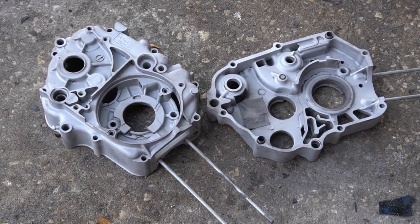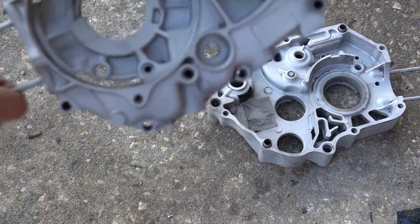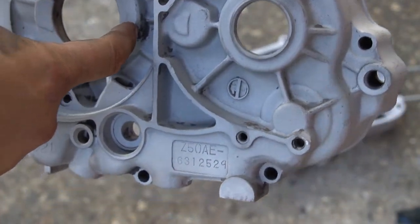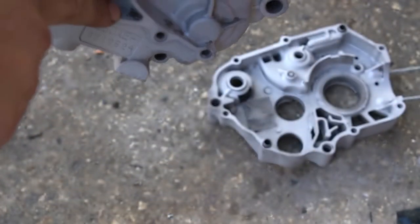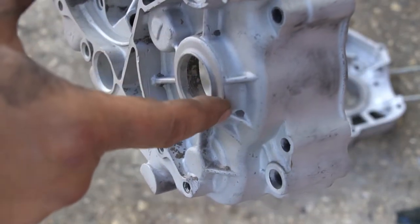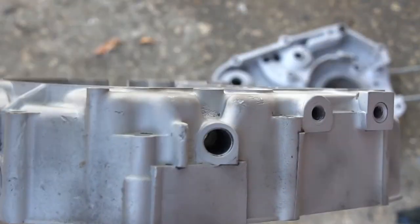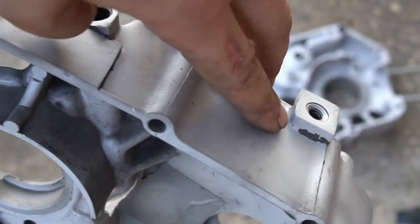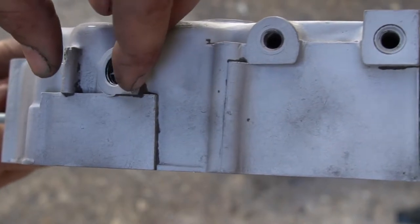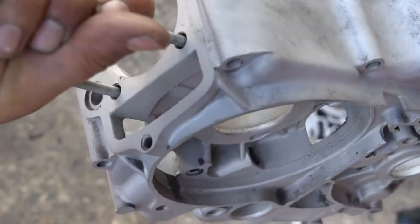About 20 minutes in the dry blast box here. There's some stubborn areas, like in the nooks and crannies, that when there's a lot of buildup, it's just hard to get the media to get that out. But I'm gonna come back with a little wire wheel setup on the Dremel style tool. So it kind of just bounces right off of this buildup of gunk and stuff when you're shooting it with the media.